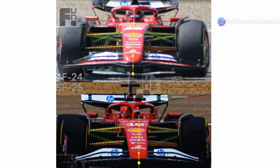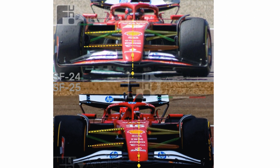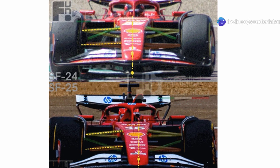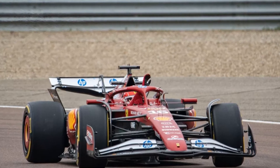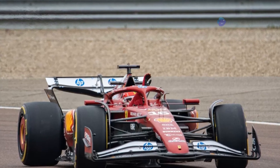Looking at the following image, we notice a very different arrangement of the triangles compared to the previous configuration. By examining the photographic comparison, we can clearly see how the front quadrilateral — referring to the upper and lower first arm and the distance between the triangles on the chassis side and the hub — has undergone a very invasive modification.